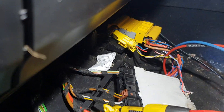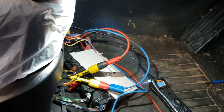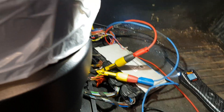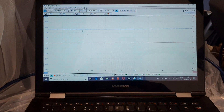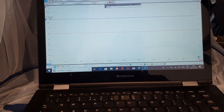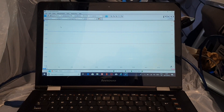What we can do is plug it all back in, which will restore power and ground to the module. We've connected the PicoScope up. At the moment, we're tied into the back of those two CAN network wires. As you can see, we have zero volts on channel B, which is the red channel, and on channel A we have about 10.5 volts. This is a bias voltage being sent out by the module itself — it will not operate on the CAN bus until it is told to operate.